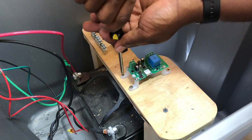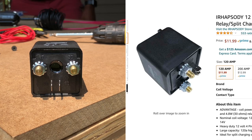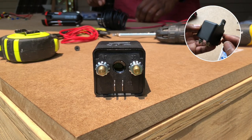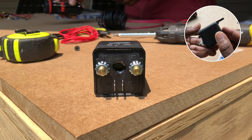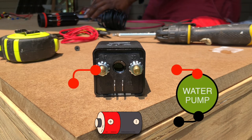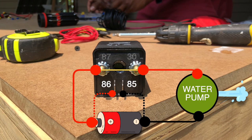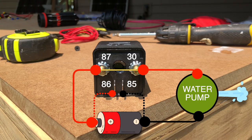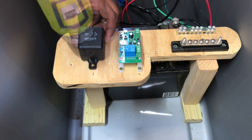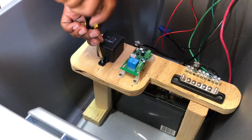Once my WiFi relay was properly fastened down, I moved on to the new star of the show — a heavy-duty relay rated to handle 120 amps. You might be asking why I needed a relay this size, and the answer is because it would allow more room for growth in the future if I wanted to power a larger pump, and it was only $12. To quickly summarize how this relay works: when I supply 12 volts to terminals 86 and 85, the relay contacts inside close and allow whatever is connected to terminals 87 and 30 to operate — in my case, my water pump. This takes a huge responsibility off the WiFi relay having to handle the large load the pump could potentially draw.